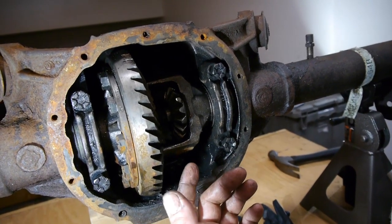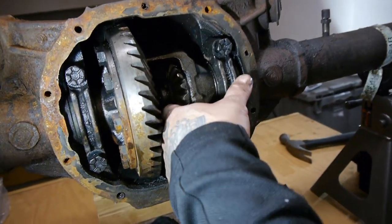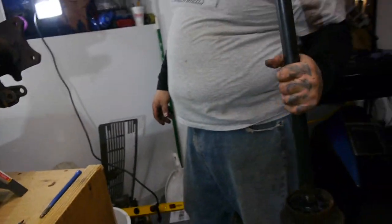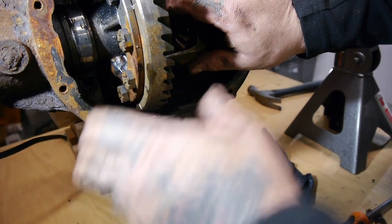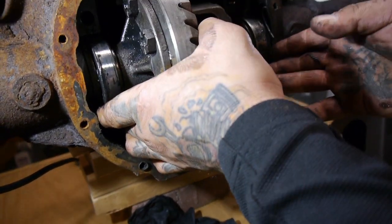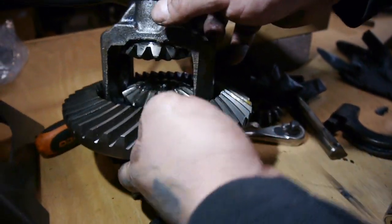Before removing all the gears, always remember to remove the ABS sensor from the brake plate, because it won't allow you to just push this guy off. Get that guy out. Here comes your axle. And we are no longer going to use these. Out it comes. There it is.